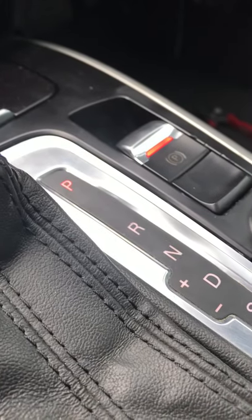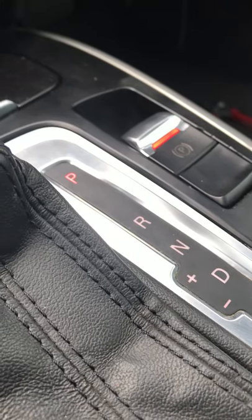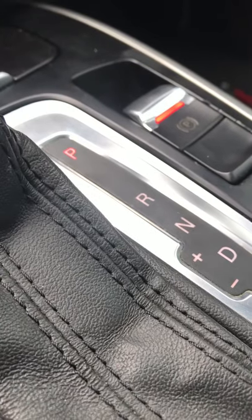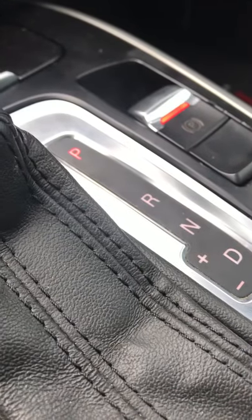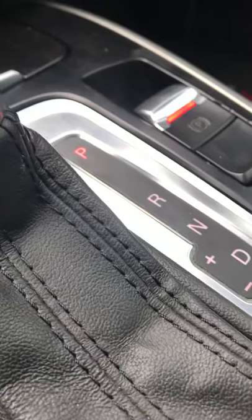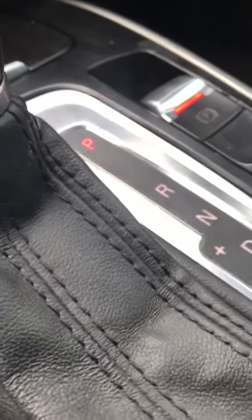The issue was there was no light coming on the parking brake, and when you push the handbrake down or up you can hear the motor on one side but not the other. That was a clear sign something was wrong, and on top of that the dashboard was flashing a warning saying 'parking brake malfunction, see workshop' or something along those lines.